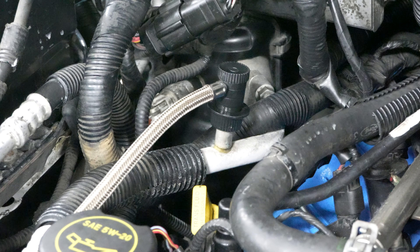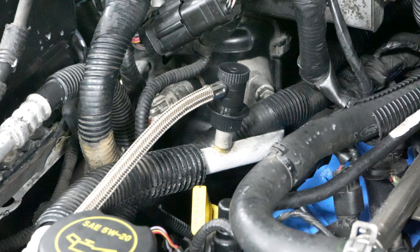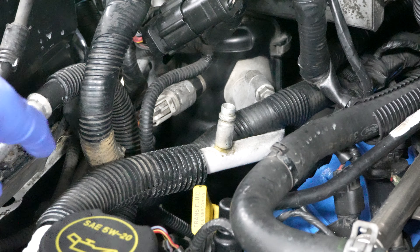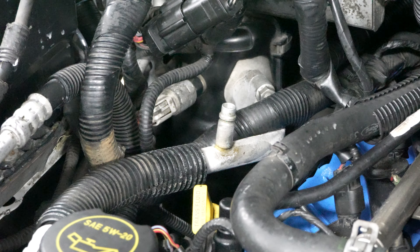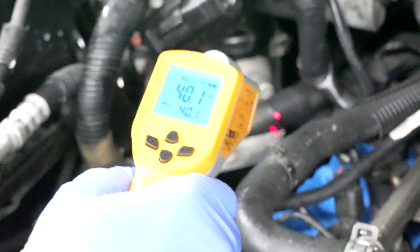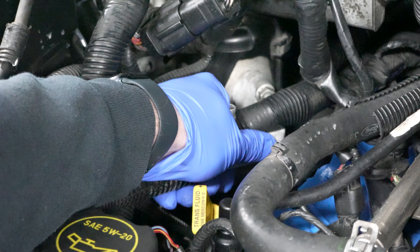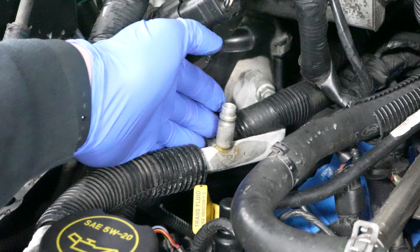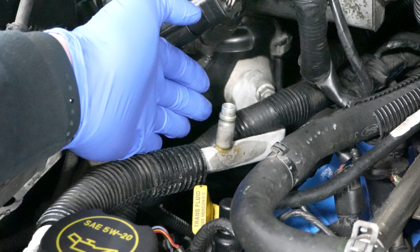Clearly there's enough refrigerant now. I'm actually pretty happy with how much is in there. If you think it needs a little more, add it, but putting more refrigerant in won't give you any more cold — once it's hit cold, that's it, you're done. I can even see frost building up on the low side pipe. The gauge reads 40 degrees Fahrenheit and you can grab it with your hand to feel that it's very cold, with frost beginning to develop.